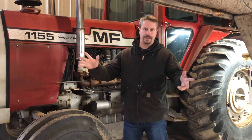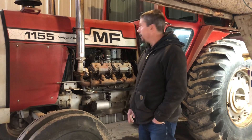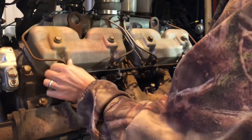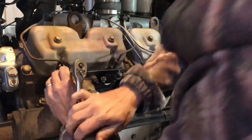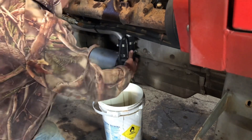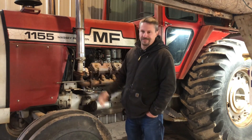Before you guys go jacking me up about that, let me tell you what I've done. I wanted to make an entire video on that, but the problem is I can't find out where it's coming from. I took a couple days working on this. I drained all the oil, pulled the injectors, pulled the oil cooler, filled the antifreeze to the top, pressurized it, let it sit for a couple days, kept pressure on it all the time. I got nothing. It holds good pressure — holds 15 psi for a pretty good long time. The only reason it was bleeding down was because the pressure tester I borrowed wasn't brand new, let's just say.